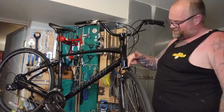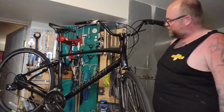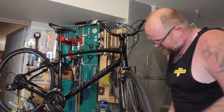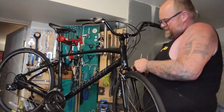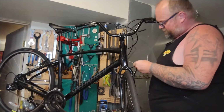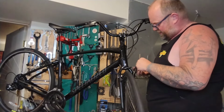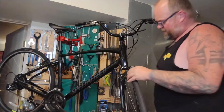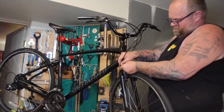If you get a kink in here, in between the brake arms, your brakes will be mushy forever. You're always unstretching the kink instead of putting brake force on. It is no bueno, so we'll be doing a new brake cable if that is the case. That's always sad, man. Cables aren't cheap. Did I overtighten this? No, there's no kink. It looks alright. Good old me trying to get stuff tight without overtightening it.